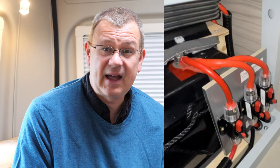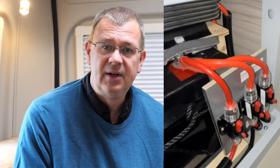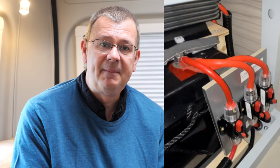There are a couple of bits I'm going to improve on from the previous video — really appreciate the comments around the breakers not being up to scratch. I had to replace one of the lower-power ones. I did have a 250-amp single breaker, but I gave that one up because the contacts just didn't look up to the job. What I'm going to do is replace it with a rotary switch — the typical type used for battery isolation — so I can properly isolate the battery. I'm going to put two of them in.